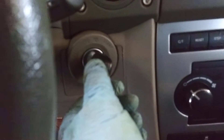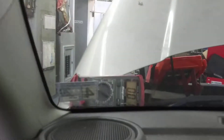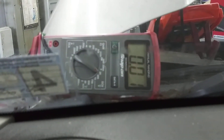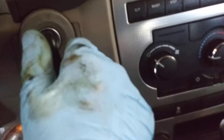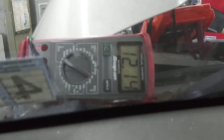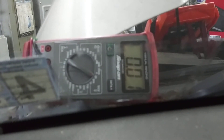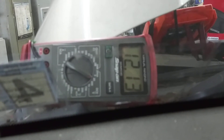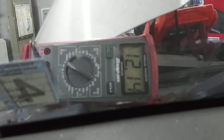Basically, when you turn this key to start position, you send a 12-volt signal to your starter motor to start the car. We have already tapped into that with our meter, and what we're going to do now is look at voltage on the meter for the signal wire to the starter. I'm going to turn the key to the start position and look at my meter — I see that I do have a 12-volt signal to my starter. I release the key and it goes back to zero. I try again and you'll see I've got a nice voltage signal to the starter to engage the starter motor.